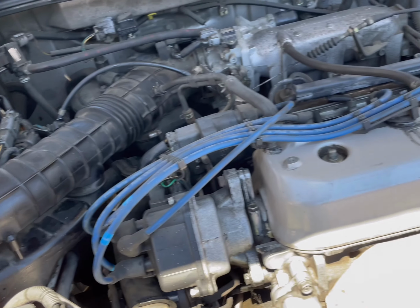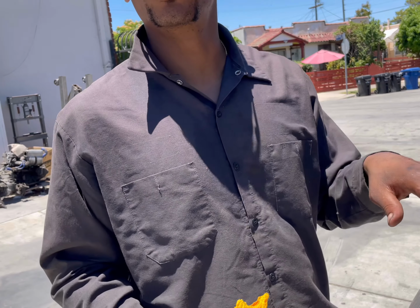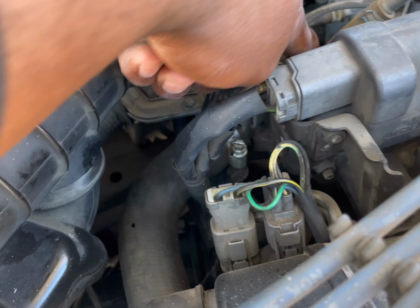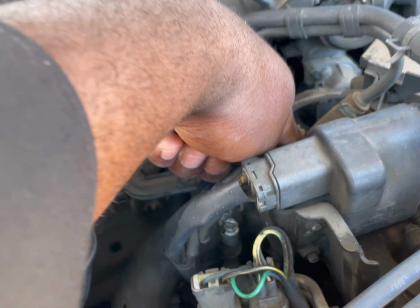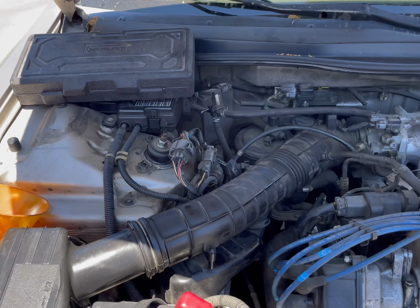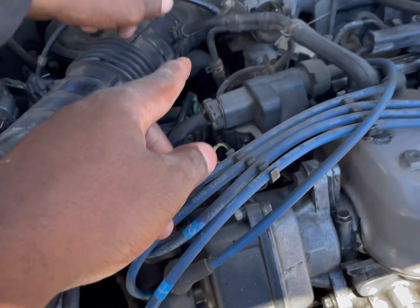Heater core, which is the smaller radiator, you're verifying that the coolant is able to flow completely through the hose, from the radiator, through the hoses, all the way through the engine block, and actually into the smaller radiator and back through the engine and through everywhere else and back. You're verifying that the coolant is fully flowing through the system completely. So what I do is I fill coolant right here, and I open up this tab right over here. It's called a bleeder screw. It should be flowing purely and with no bubbles in it. After you open it, you keep pouring coolant in here to make it continue to flow out there, and you observe it.